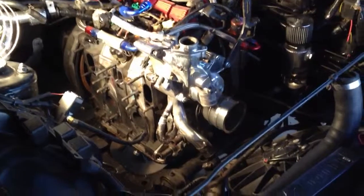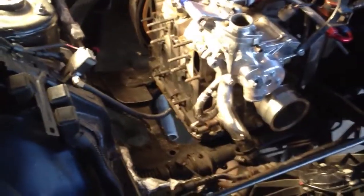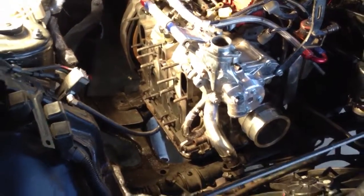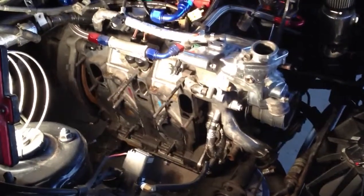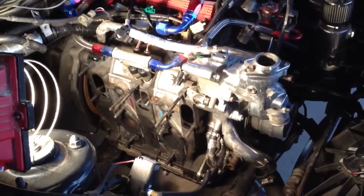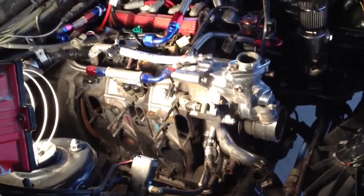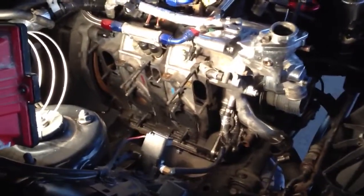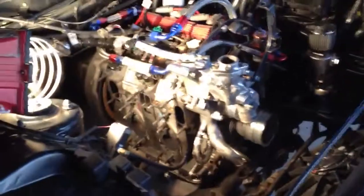But just heads up, if you do have an RX-7 and maybe you just got it, you're trying to learn some stuff on it, do not turn the boost up unless you got good gas or octane booster or race gas. You just need to stay around 10-12 pounds of boost otherwise, and that'll save your engine. It ain't worth doing all this stuff just to replace the apex seal, because there just ain't none that'll withstand detonation if you boost high enough.